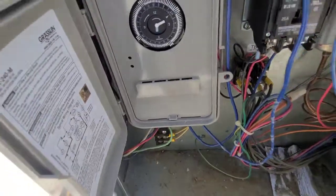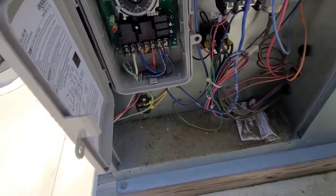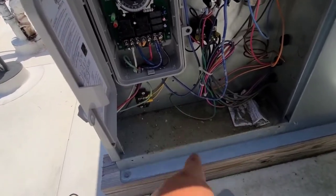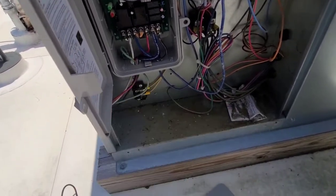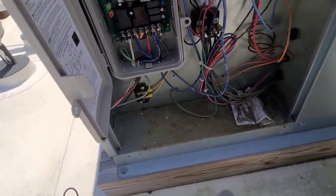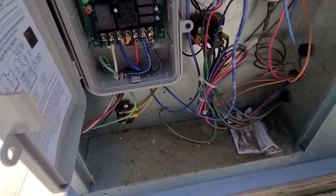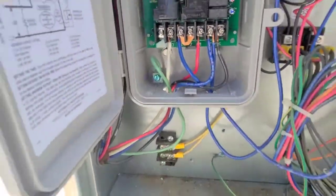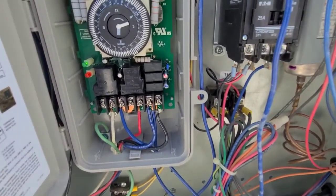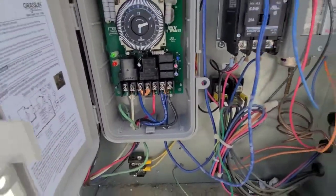About every 6 hours, which is pretty normal. This one has electric heaters at the coil — those heaters are going to energize for about 45 minutes and thaw all the ice that's built up on the coil as it was running. Of course, if it gets too hot and reaches a temperature, there's a termination — it'll say hey, I've reached the temperature where it's safe to come out, so it'll come out of defrost prior to the 45-minute increment if it reached that temperature.